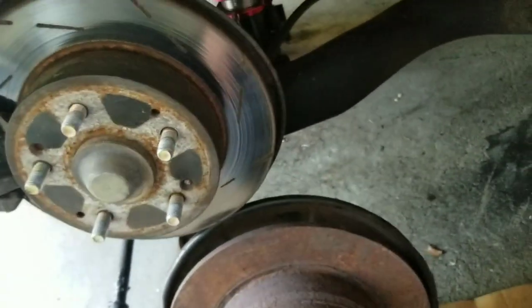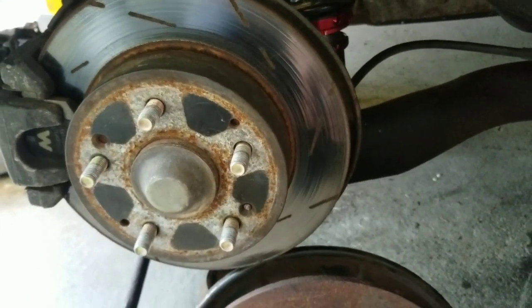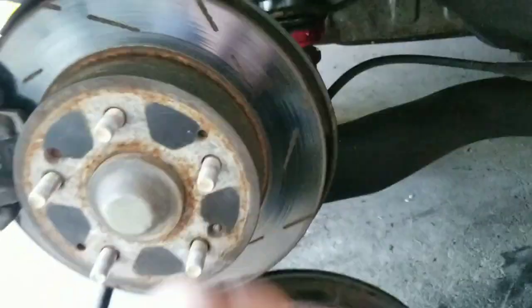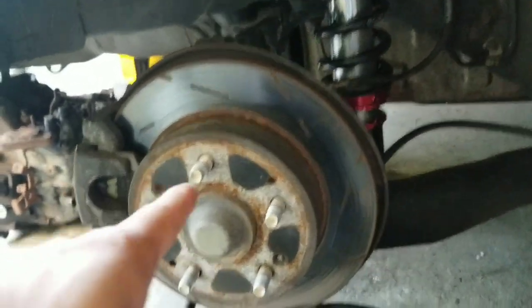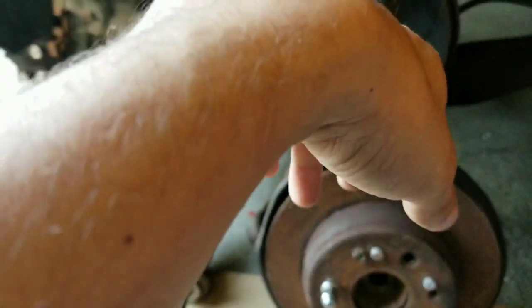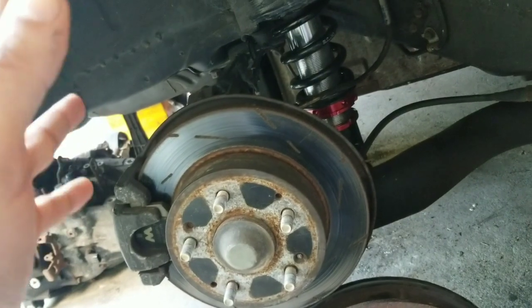If the element spindle doesn't fit on the RSX trailing arm, I may have to get trailing arms from a CRV. I'll call a couple people who've done this before. There's not a lot of information out there on the internet and it can be intimidating, but I'm not really intimidated. This is my winter project — I don't know exactly how long it'll take, but hopefully not as long as people say. So I'm gonna take the spindle off and start mocking it up.